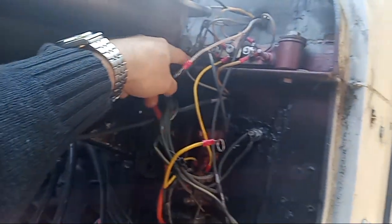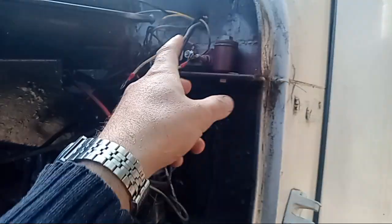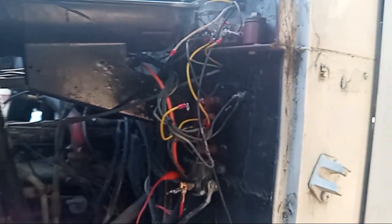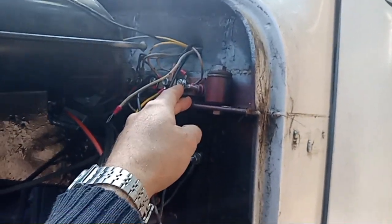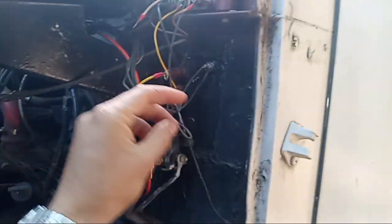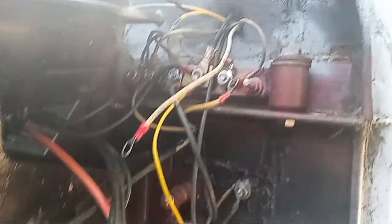The same should apply to the green and blue wires for the right turn signal — I haven't tested that side yet but it will be the same thing. The orange and yellow are connected inside the cam, but I much rather have it connected at the terminal bar. From there I'll run one wire to the front and another to the back — that way it's nice and organized.